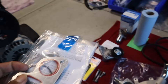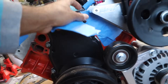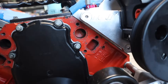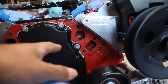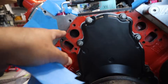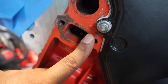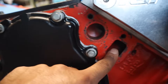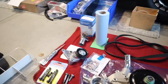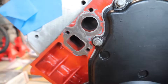You obviously have to take your old water pump off. The ports are here — I had them taped off so nothing gets in. Whoever painted this motor painted the inside kind of poorly. With a gasket scraper, you want to get all these surfaces nice and flat and clean. I already did it once; I'm going to go over it one more time on both sides, get it nice and clean, then we'll throw on the water pump.